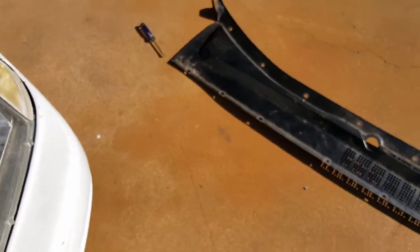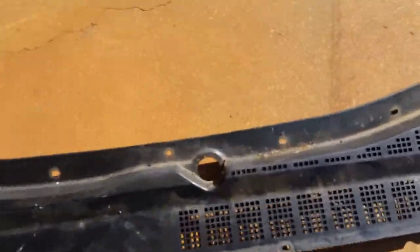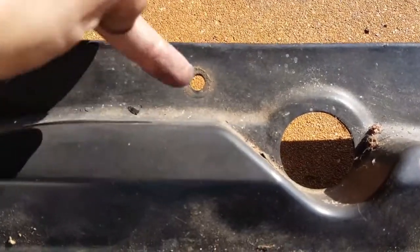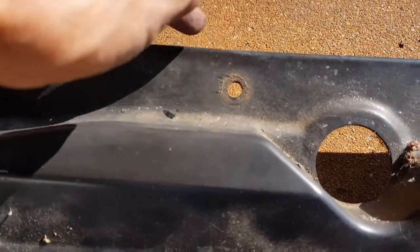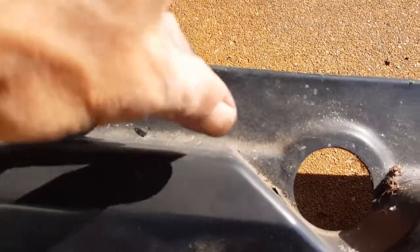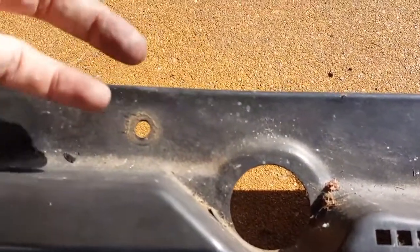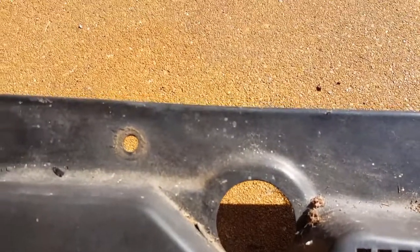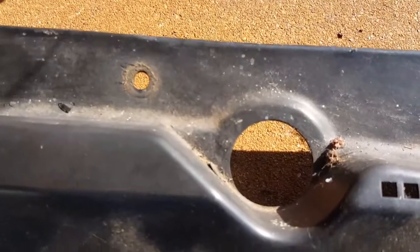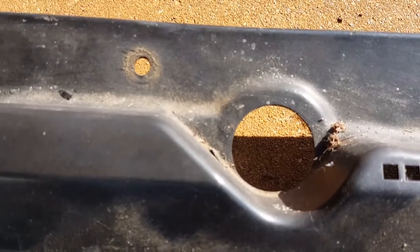This car is kind of a daily beater with 160,000 miles on it. The top fasteners are real easy to undo — they're screw-top style. You unscrew the center screw all the way and pull it out, then stick your tool underneath and pry it up. Do it that way so you don't strip the threads on those little screws.